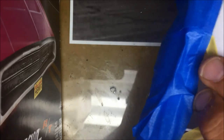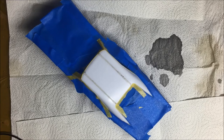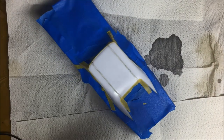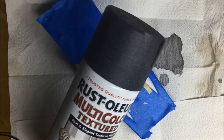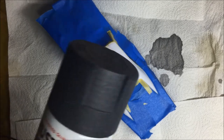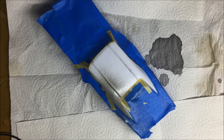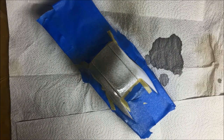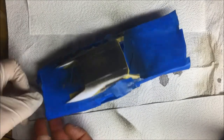I've put blue tape here because the paint I'm going to spray tends to get everywhere, so I want to make sure to cover the body of the car to avoid overspray. Now we are ready to paint the vinyl top — everything is masked off. What I use is this Rustoleum multi-color textured paint. It's kind of a gray and white speck, and it doesn't really matter because we're going to be painting over it anyway. Just light, light shots — I'm not trying to put a lot of paint down, just enough to cover.